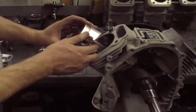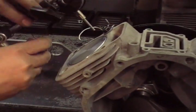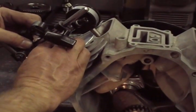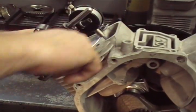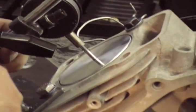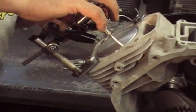First off we're going to put this piston in here, slide it right in, and we're going to find top dead center. That's done by putting a dial indicator on top of the piston. We'll get this thing on here first — we'll use a one-inch dial indicator. Tighten it down. Now we're going to put this on top of the piston, right in the center of the piston is preferable — that way it won't rock and you'll know it's an accurate reading. Tighten it down there and we'll zero this thing. We're going to bring the camera on this side to show you what's going on.